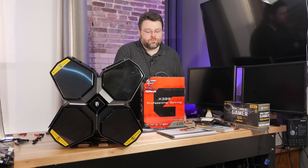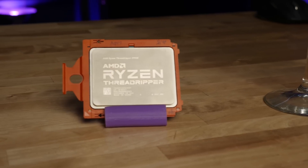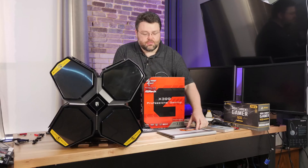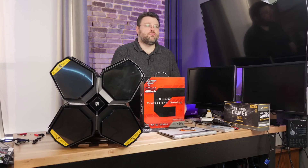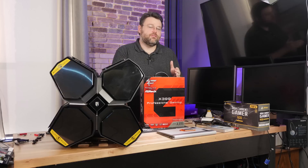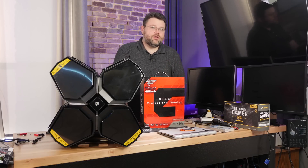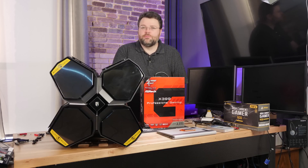You will need to use it in a case with a lot of airflow. When it's allowed to really stretch its legs, this thing is going to use 400-500 watts. With the default TDP settings at 250 watts, you're going to be running 3.0 to 3.4 GHz all-core. Almost all my testing has been done under Linux, and 3.4 GHz all-core isn't bad - you'll see 4.2 GHz on more cores than you might think.